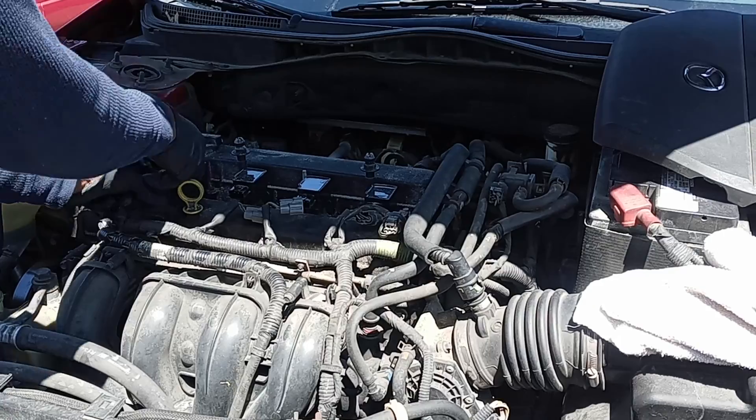Take your time, you don't want to break anything. What I do right now — just in case it needs to come over — I use some brake cleaner to spray it down at the bottom of the injector, where the injector is, just to give it a clean and get most of the dirt out of the creases.